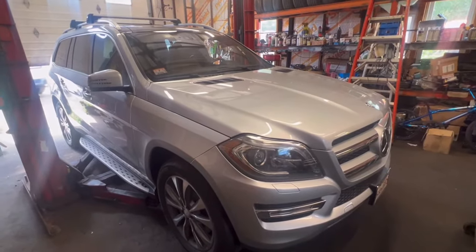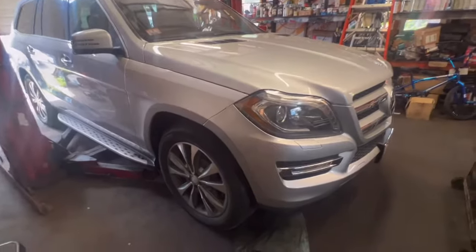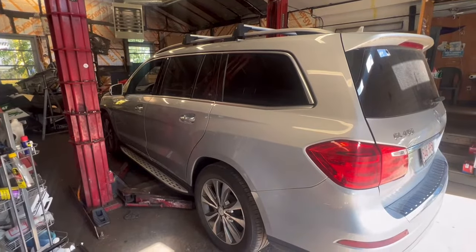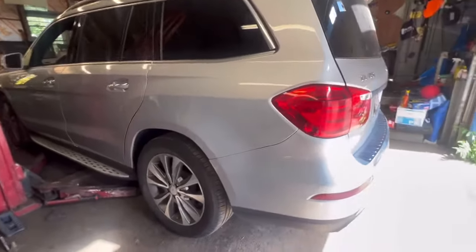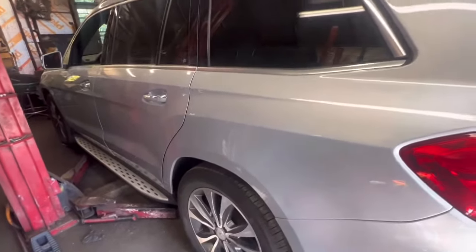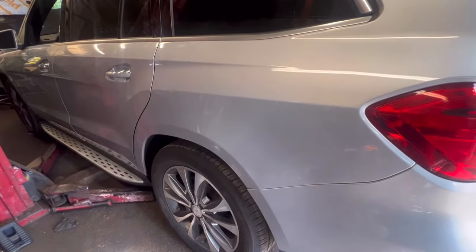Thank you very much for watching — this vehicle is all set. I'm going to walk around it. See, that side was down all the way on the left side; the right side was good. Only the left side was affected. This GL 450 is automatic. Any experience with Mercedes is going to be the same. Every time you do service on a Mercedes, make sure you close the hood before you start it, because if the hood is open, as a safety feature the air pump will not kick on.